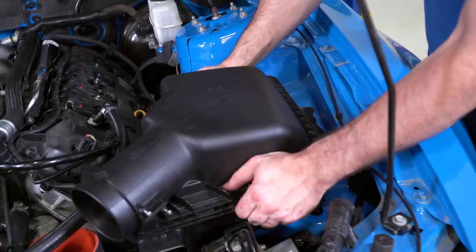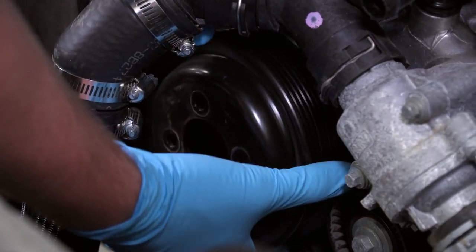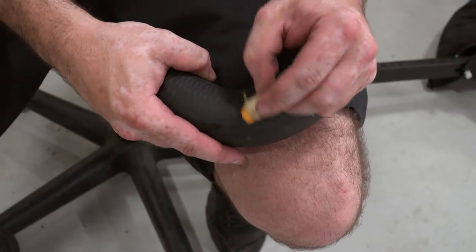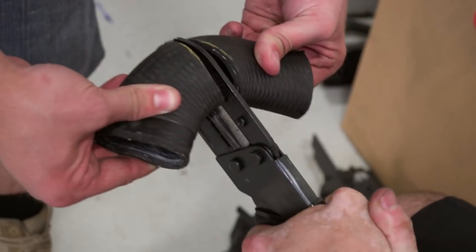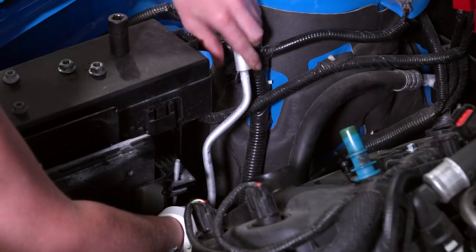You will need to pull your front bumper and your air intake and drain the coolant from the radiator. You'll remove your radiator hoses, loosen the bolts on the water pump pulley, pull the MAF sensor and the throttle body. After that, you'll have some miscellaneous prep — moving the wiring harness and beginning to modify the cooling system. You'll need to cut a few things, shorten some lines, and even modify some hose clamps. You'll spend a good amount of time modifying the cooling system to make room for the blower assembly, but you aren't making many permanent modifications — you can always buy new hoses, clamps, and a fan shroud to return to the original setup. You will need to bend one AC line to make room, but it moves easily, so just be careful.